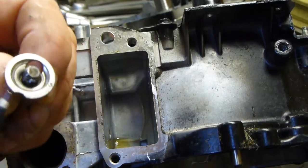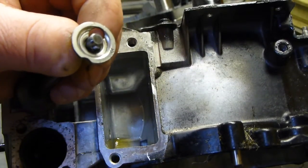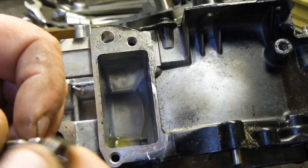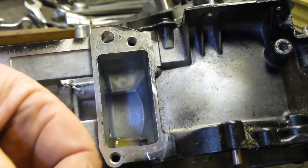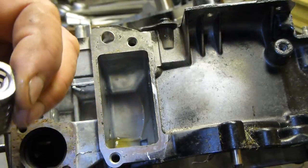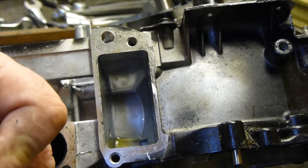Now what we need to know is that the smaller part lines up with this little notch on the side of it just here. That's quite important. So when we come to put the valve in, we're going to put the valve cap onto the valve itself and do the compressor up, with the notch facing towards the operator of the compressor.